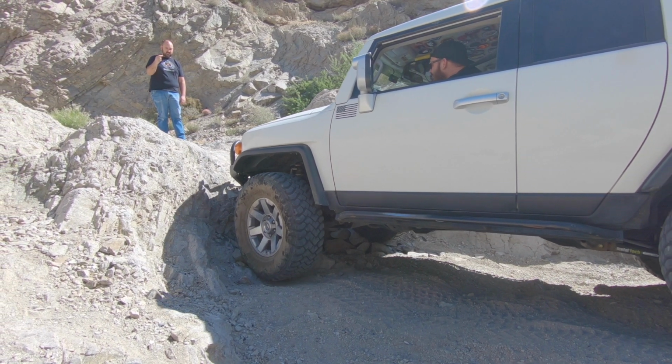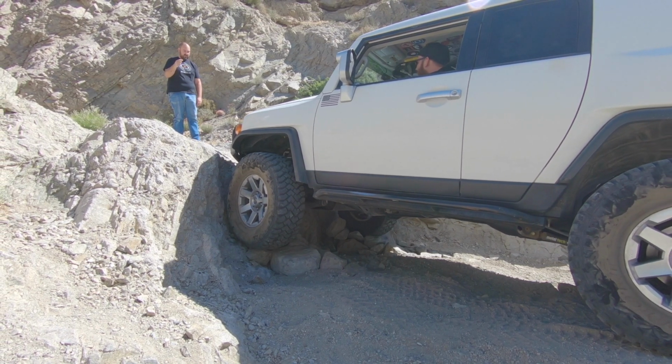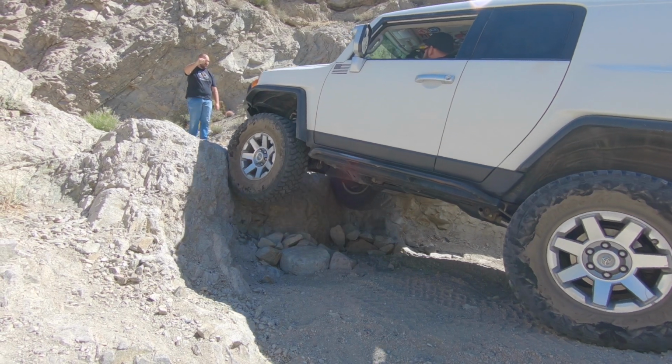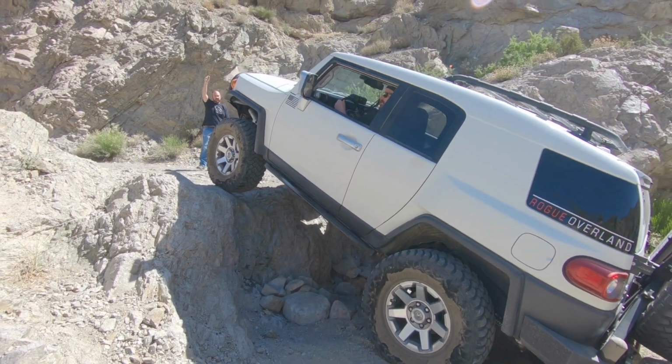Okay. And then from that cross member, there's an additional cross member that gets installed, all squared in with the steel to protect the exhaust and the tail shaft of the transfer case. So you're basically covered from the front of the motor all the way back past the transfer case. Correct. Nice.